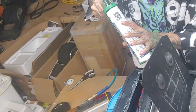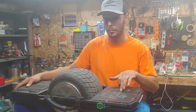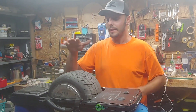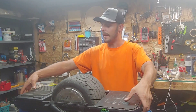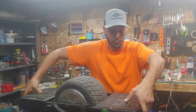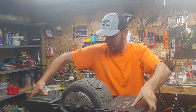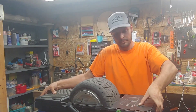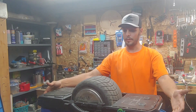We've replaced all the main components, including the motherboard, both rear sensors, and added the Bluetooth unit. We've also siliconed it all up. Now, because this is a new controller, it has to actually learn the hub. The way you do that is by holding both foot pads — one sensor on either side — and then holding the power button. It'll beep, you let go, and then it'll do its own relay.